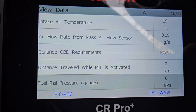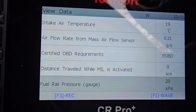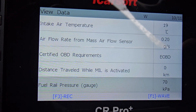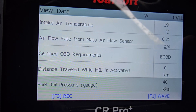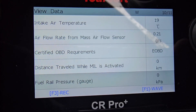So it looks like our fuel pressure sensor is now reading a bit more sensibly - it's not reading 70 psi when we're stationary. There's no fuel pressure. I checked at the Schrader valve and there wasn't really a squirt of fuel, so it hadn't been very well pressurized. Also when the low pressure fuel system is turned off it pretty quickly depressurizes itself, so that looks good. Possibly fixed a random problem I didn't know I had.